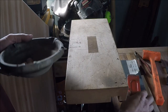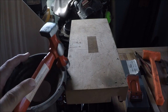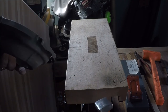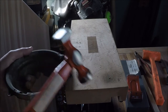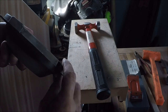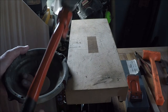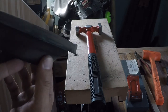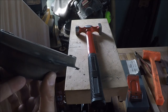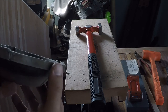Moving it a little bit. I think I need to use my block here, need to try to drive down on this thing. And you know, when you're doing this stuff you don't need to whale on these things — we're not driving a nail. Just a little tap; you don't want to cause more damage while you're trying to fix one thing. I might be pretty good right there. That's the one that was bent — I think that's looking pretty good.